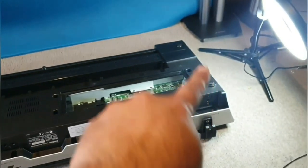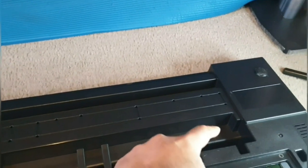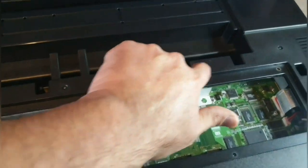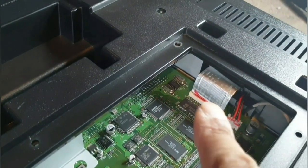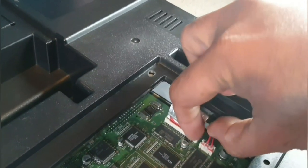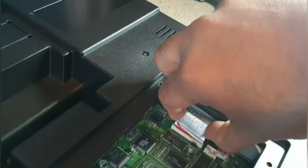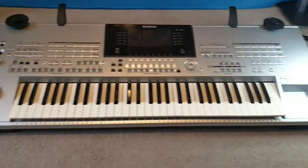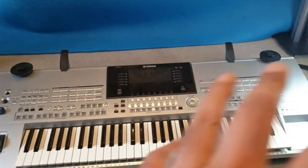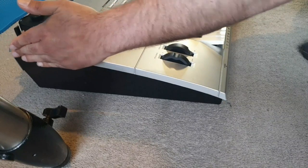You've got a few screws on the edges, some in the deeper section, and don't forget these five screws. You have to remove this panel because we need to unplug these two connectors — just grab this one and pull it up, that's one. And this ribbon cable, be gentle, we don't want to damage this. Once we've removed all the screws and the panel and disconnected the wires from the underside of the keyboard...